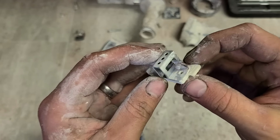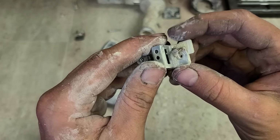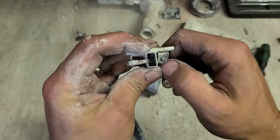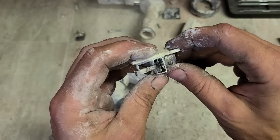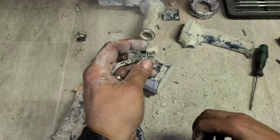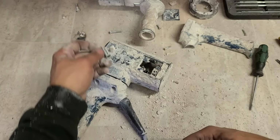That's the brush holder, and you can see she's been bent. Somebody has tried to tighten that up. Put that much pressure on, she's bent the wee tab. But either the screw or the holder's gone. That thread's not tightening up. So it felt tight, probably when the person put it on, but it wasn't actually clamping anything.